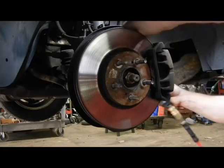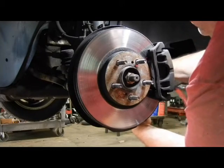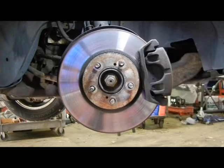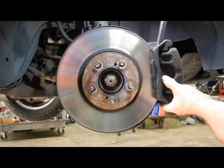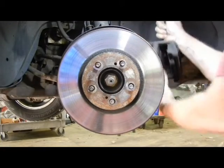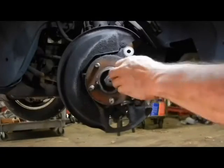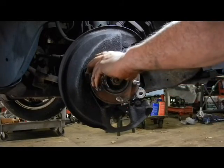To get to the ball joint, we're going to have to take the brake parts off and take it off as one piece. I have to take the caliper and adapter off, remove them and hang them up with a hook so as not to damage the hose on the brake line. Then take the disc off, and remove the nut off the drive shaft in order to get to that ball joint.